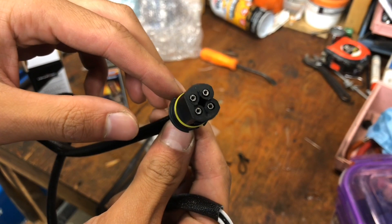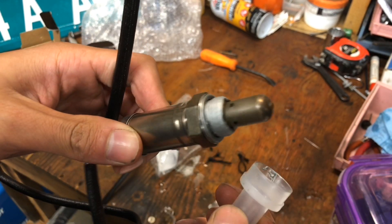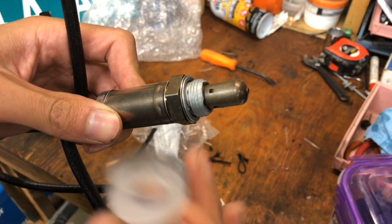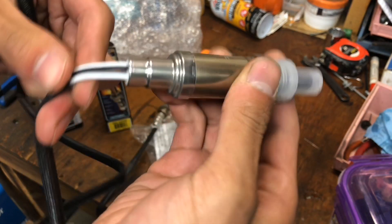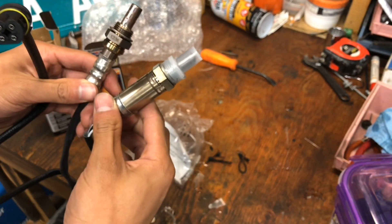This plug is yellow; the other one was green. All the plugs on this engine are different. If I take this cap off you can see the silver anti-seize. Anti-seize is used as a lubricant to prevent rust and corrosion. Here on the back we have four wires: two for heater, one for signal, and the other for ground.